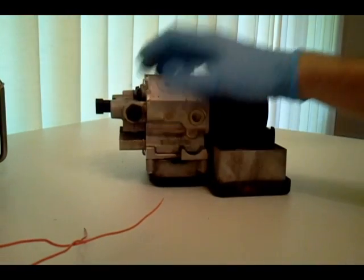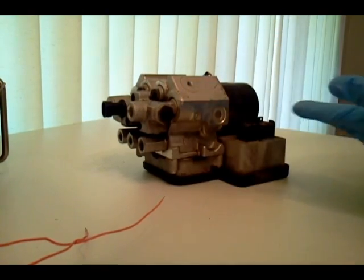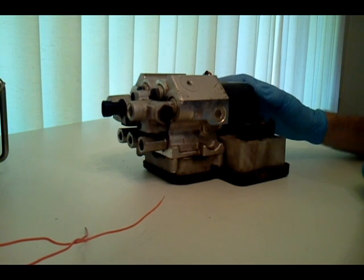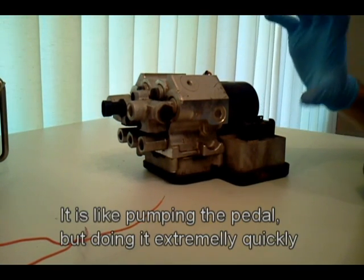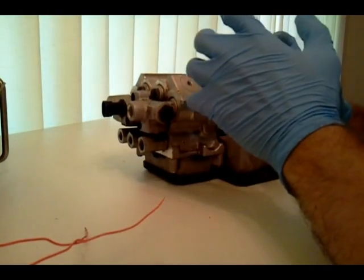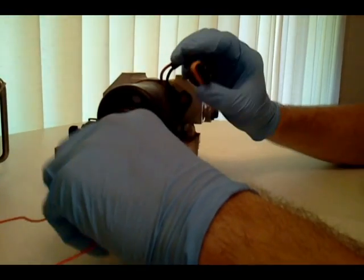This is an ABS motor. When you slam really hard on the brakes and your wheels lock up — when your wheels cease to turn and you just slide — this turns on and off your brakes on selective wheels. The computer decides which wheel to turn on and off, which allows the wheel to continue rotating while you're braking. This lets you control your turning and supposedly decreases stopping distance in a skidding situation.